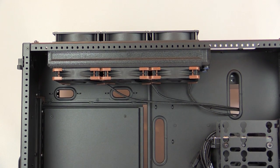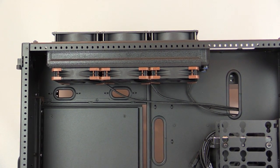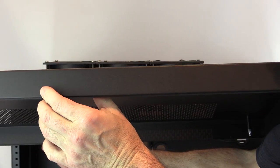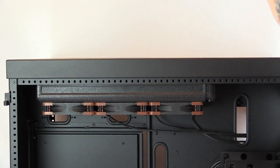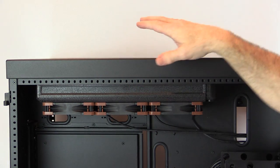The reason you can do that in this configuration is because of the optional top I chose. There's a flat top that doesn't provide thickness for fans, but there is a 30-31mm optional top that covers the push-pull radiator completely. Placing this top over the chamber gives you the push-pull configuration with complete venting — in this setup, air comes in through the front and exits out of the top.